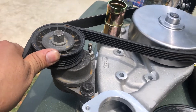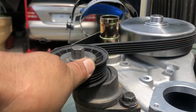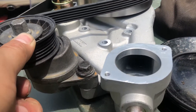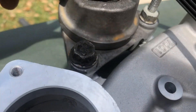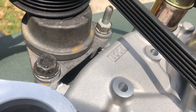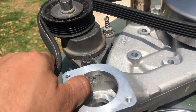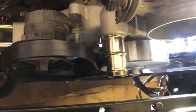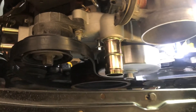I messed with the tensioner already — I grinded it down first, cut off the little legs where it mounts on the actual tensioner, and now it lines up perfectly where it's supposed to. I gave it a few hand turns and it lines up perfect. I took seven-eighths off to match up with the spacers used on the water pump, and I had to cut the triangle off the front — that wasn't gonna work. This is what's left; it should work. This is the one off the truck. Moving along — this is the Mercedes serpentine setup in the front with the alternator, power steering pump, and water pump.